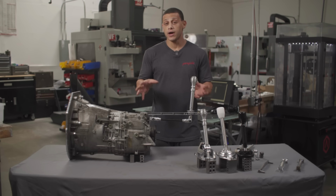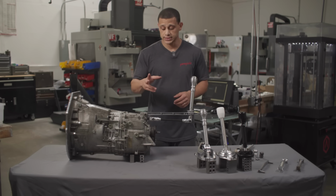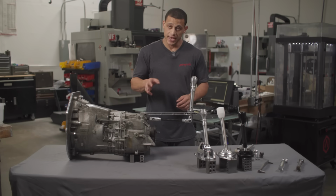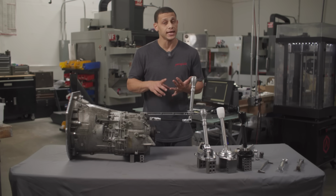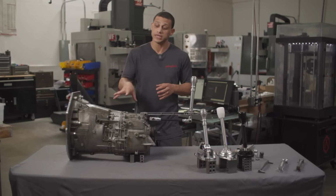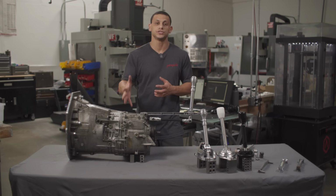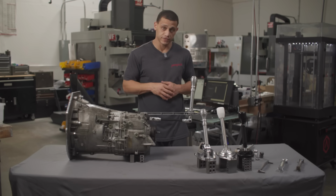All the shifters that we're now going to talk about are solid mounted, which will mean 2 things. It'll mean that you're going to eliminate this carrier assembly and all of the components that cause play in that. And the transmission has to be solid mounted to the car, either through 80A, 95 Delrin, or aluminum transmission bushings. You don't want your transmission moving differently than your shifter. That's how issues can be caused with shifting, not being able to get it in gear. You're gonna have to use any of the harder transmission bushings when you're using any of these shifters.